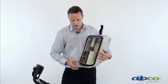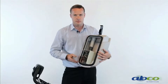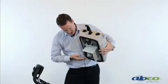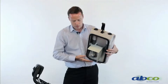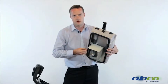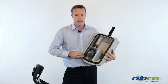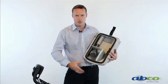We want to reduce the amount of foaming inside your tank. This can be done by reducing the amount of chemical or changing the type of chemical you use. We recommend a low-foaming chemical, because as the water comes up it picks up the ball float and blocks the suction. If we have too much foam, the water level will be low but the foam is not heavy enough to pick up the ball — therefore that foam will get into your suction motor, destroying it due to moisture, and your bearings will fail. Please note: if this does happen, it will not be covered under warranty.